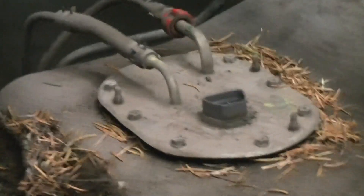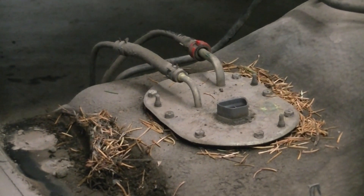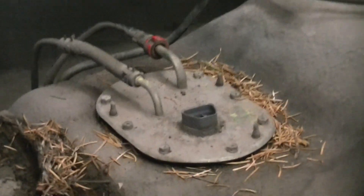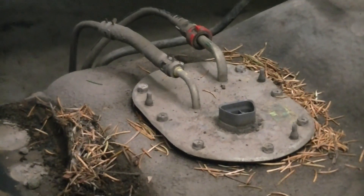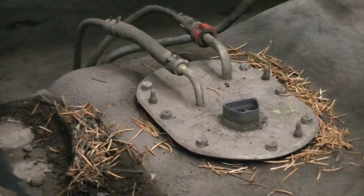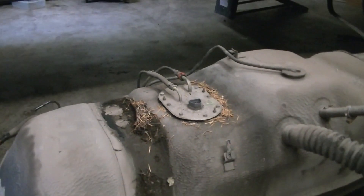You can try to free it up by reversing the polarity to it, which I did, but this one is just locked up again. This truck has 190,000 miles — never had any issue, and then all of a sudden the fuel pump just locked solid. Sometimes they do that. It's weird, but they do.